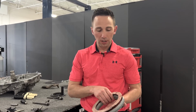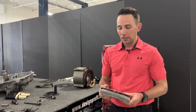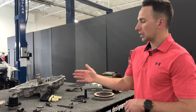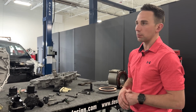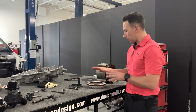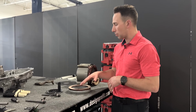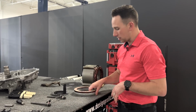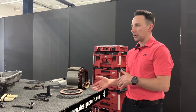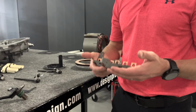You're going to be more efficient as you start to approach your outer limits of the ideal temperature range, right? These guys will get less efficient at super high temperatures. And so keeping those cool is certainly advantageous from an efficiency perspective. So not only are we seeing that with the stator that we see here and the cross sections and the electrical elements, the bus bars, these phase leads, they're benefiting from going to 800 volt there, but they're supplementing that by cooling the phase leads themselves.